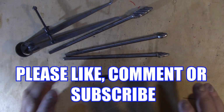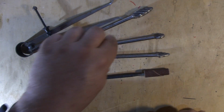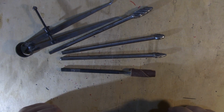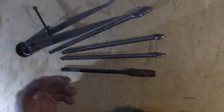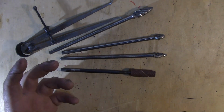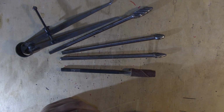And I wanted to cover two things today. I had some questions about why would anybody use an FE nowadays, and what was I going to do with these burrs without a CNC machine. Well, the FE motor, as I said before, is one of the most researched and developed Ford engines there is. Yes, they have their limits depending on what block you use, right? You use a stock block, aftermarket block, base 390 block, 427 block. It all depends. But typically, 390 blocks are good to about 600 horsepower. Some of the other blocks are good up around 750.